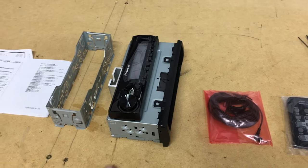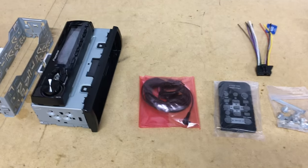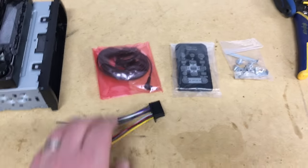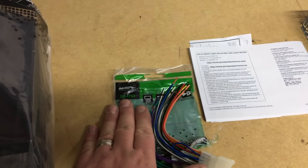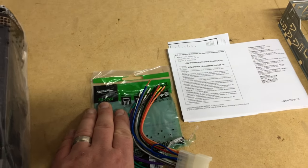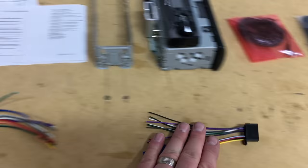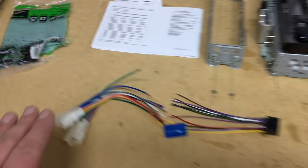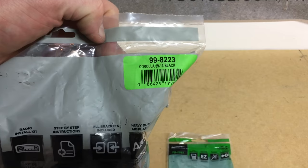The radio that we will be using — go ahead and check the link in the description or on the video here. You'll be able to see the unboxing and what all comes with it. One of the main wiring harnesses it comes with is this one here. The two additional parts besides the radio you're going to need are the dash kit and wiring harness. The wiring harness we're using, being the non-amplified Toyota version, is the Metra 70-1761. This plugs into the factory harness so there's no cutting needed. We're going to match colors from the Pioneer side and the adapter side using crimp caps and our crimp tool. The dash kit we're using for this vehicle is the Metra 99-8223 for single or double-din radios.